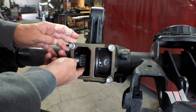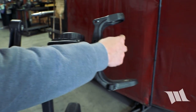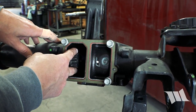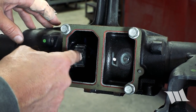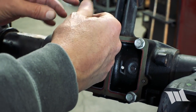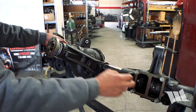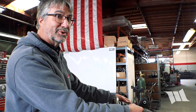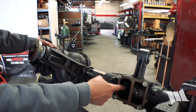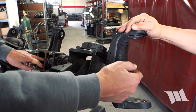If you look inside here, this is an axle shaft that engages with the differential, and then there's another one that engages with it and comes out over here with the U-joint. There's a collar, and when you're in two-wheel drive driving down the highway, this collar moves to one side. Since it's not engaging both shafts, it allows the two shafts to spin independently. The wheel turns the axle shaft forward, spinning the differential gear — which can be open or locked, but in two-wheel drive stays open — spinning the opposite shaft in the opposite direction while the disconnected shaft turns forward with the wheel.